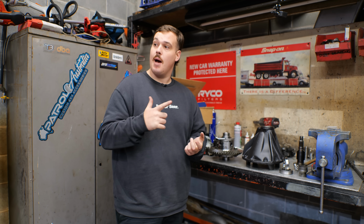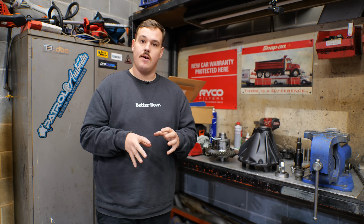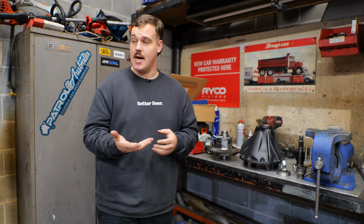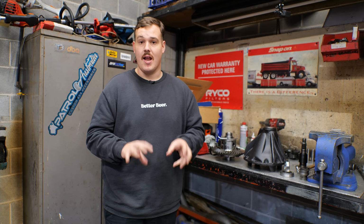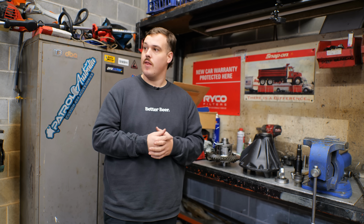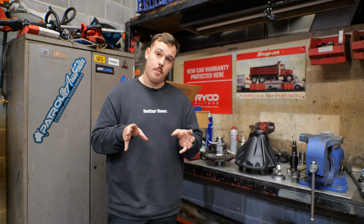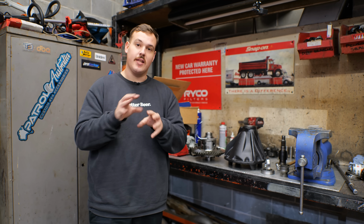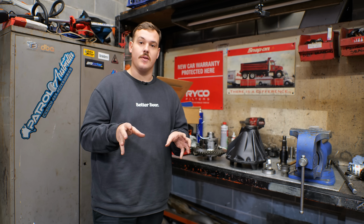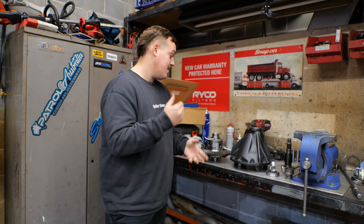In the rear, we're also going to be upgrading from the 8mm to the 10mm axle studs for now. And we're leaving the dowels as the 8mm because we're probably going to be running RCVs later on, and we just don't know what sort of dowel size they're going to need. So we're just putting factory axles back in it for now, factory CVs in the front. We're upgrading those axle studs. We've got this all happening. We're going to be hoping for the best, but I think if we drive knowing that this might be a weak point, I think we're going to get away with it. So, fingers crossed. I'm going to get out of the way, let Dave finish up what he's doing here.